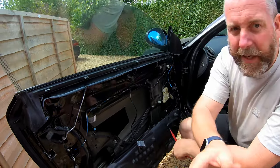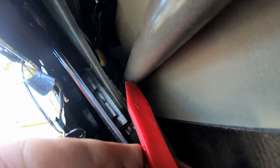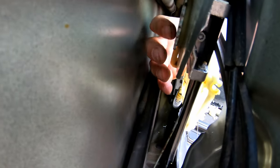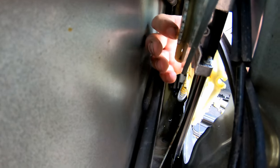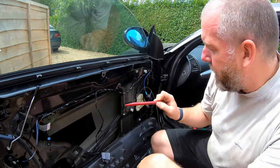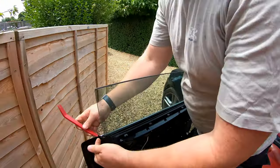Just here — like a star-shaped wheel. I'm not sure if it's going to show on camera, but just behind there is a star-shaped wheel, and the same on this side. Those need to be removed before we can take the clamp bolts out. So we'll do that in order. But the first thing I'm going to do is remove the window trim on the outside of the car — that's quite easy. Just take a non-marring plastic tool and pop it up, then gently prise it up all the way along.